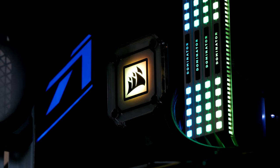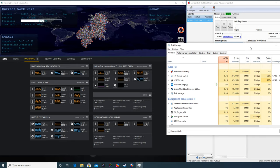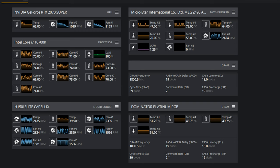For testing I ran benchmarking software and then ran Folding@Home all day long from early morning to late evening, using 100% of my CPU and a significant portion of the GPU, in a room with windows and doors shut on a pretty hot day. The results were good: around 70°C on the CPU under 100% load, 65°C on the GPU, and about 50°C on the RAM. The fans do get louder under load on balanced mode, but on quiet mode they are ridiculously quiet.